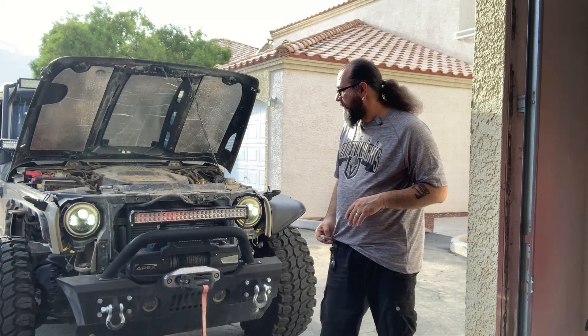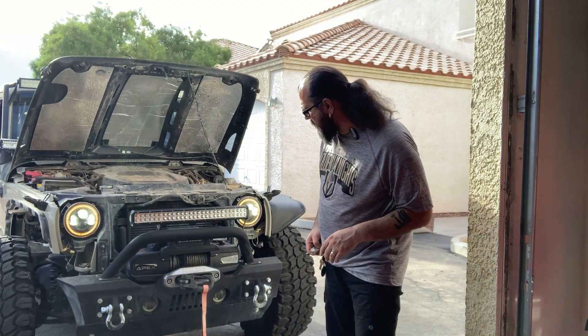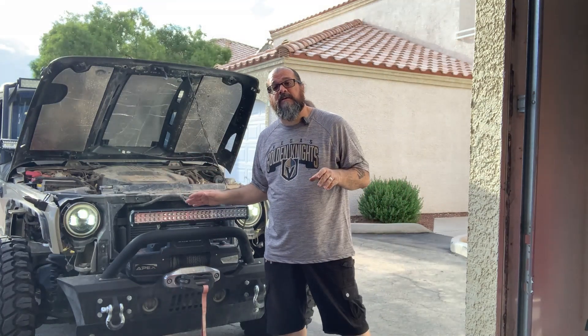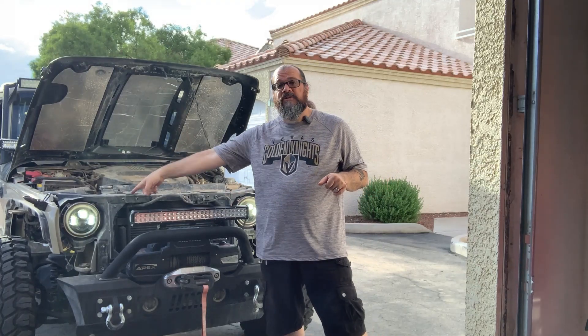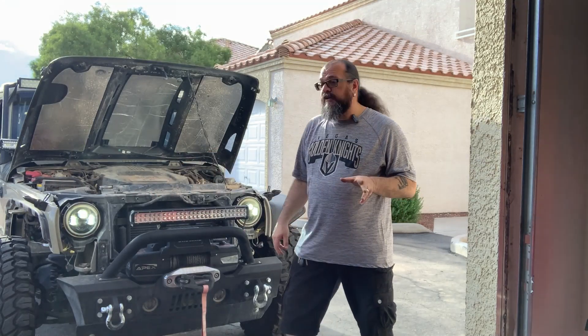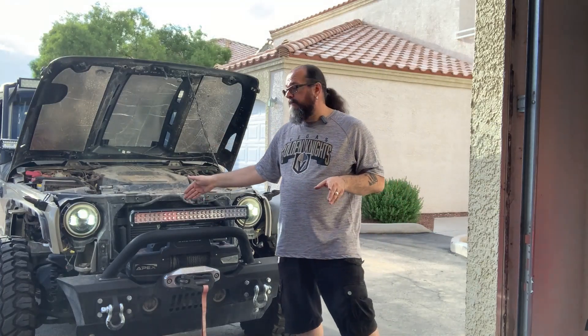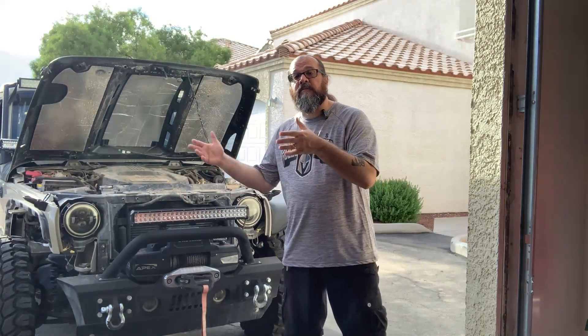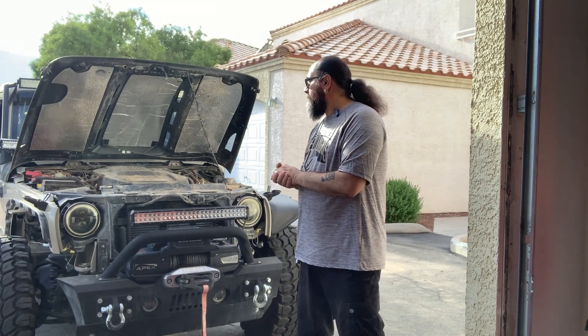We're going to give this one more little flicker — headlight's still working, looks beautiful. The only thing I'm going to do after this is close my garage door, turn on the headlights to make sure they're still aligned with each other, and readjust if needed since I went ahead and removed it from the socket. From this point I just got to put it all back together — replace the grill, put it back where it goes, replace the inner liner and the fender — pretty much the same steps in reverse. I'd like to thank you very much for watching. Thank you for joining Defiant Jeep. Don't forget to join us at DesertRegulars.club — we'd love to see you trail with us. Have a great day.